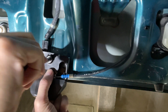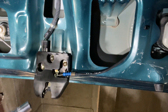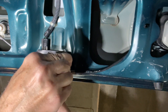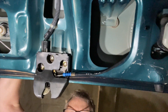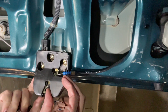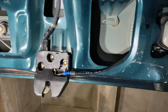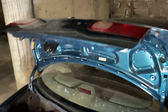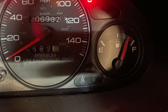Almost ready — all that's left is to reattach those bolts. I'm using a screwdriver attachment on my ratchet set for the 10mm to get them in quickly, but make sure to tighten them because there's mechanical force when you slam down the trunk lid. Quick test: cock the mechanism and open it with the key — insert it into the key cylinder, turn it, and it works. Let's cock the lock one more time to verify the release from the driver's seat works as expected — and indeed it does. Final test: does the trunk lid close properly? Yes. Can you reopen it with the key? Yes. And does the trunk open light go off when we close the trunk? It does.